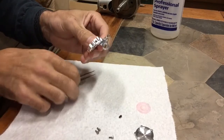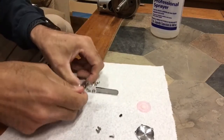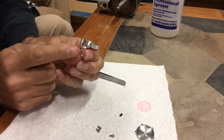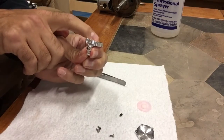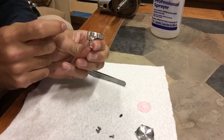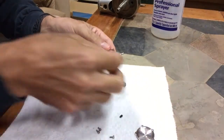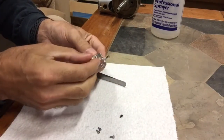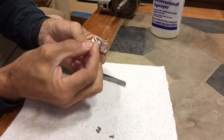Put your thumb on the assembly and slide the pin back in where it belongs. After you're done with that, you can cover these holes right here and blow through this hole while operating the assembly — you can tell whether you've successfully cleaned it or not. If you get any blow-by when you blow on it, there's still something wrong with the assembly and you probably need to do it all over again. If there's nothing wrong, go ahead and reinstall your diaphragm, reinstall your plate, and put the set screw back in — make sure you put RTV on the set screw before putting it back in its hole.